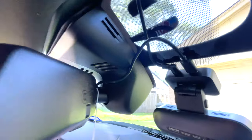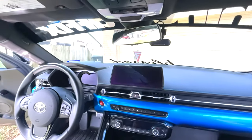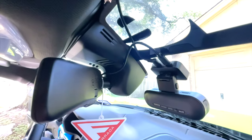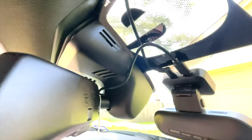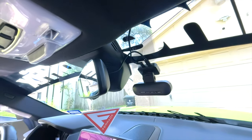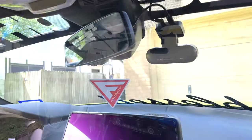Okay, now the cable is ready, everything is connected and ready to work. Now I'm gonna give my opinion about these hard wiring kits. These hard wiring kits will give power to your camera and it's gonna be on all the time, so you have to check if your camera has a parking mode. The parking mode will turn off the camera when the car is not in motion, and that will help the car not drain the battery. If the camera doesn't have a parking mode, it will be on all the time, it's gonna get too hot and it's gonna drain your battery. So check that before you get a cable like this one.